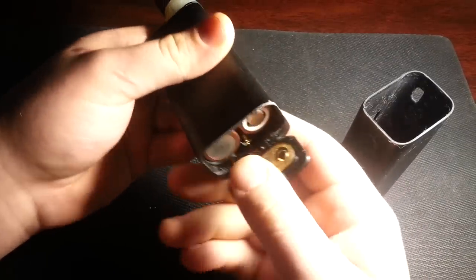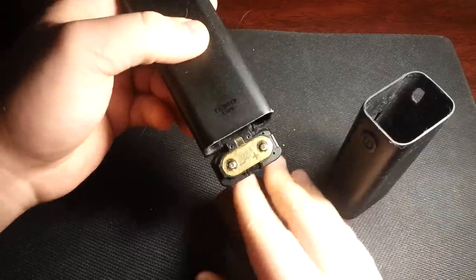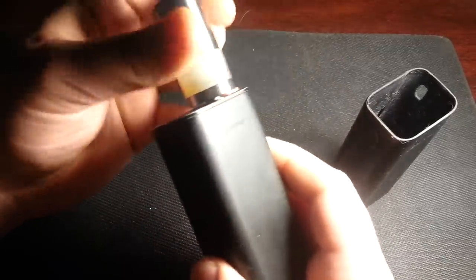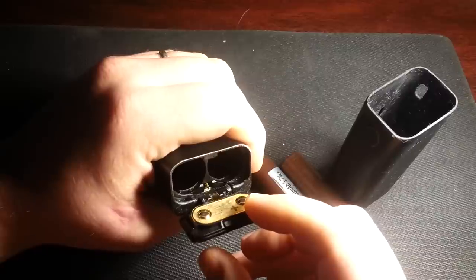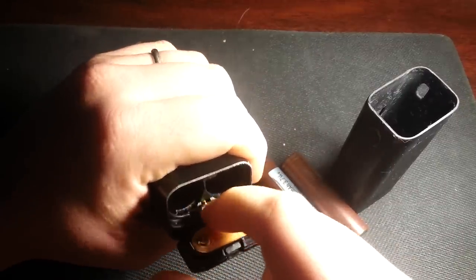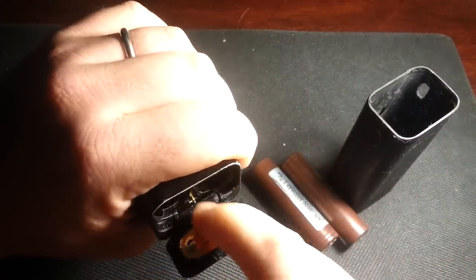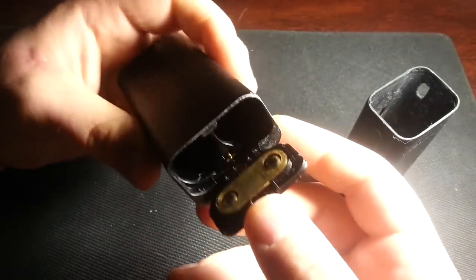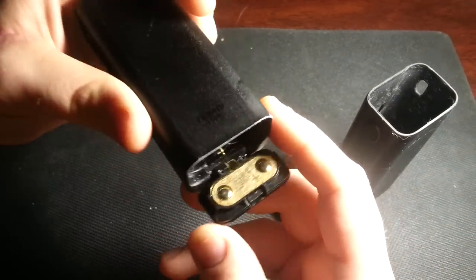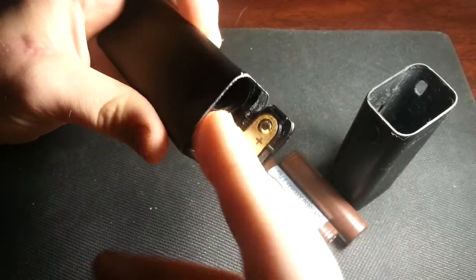What I did — it's been a while since I did it, that's why it's not working — was I took my batteries out, took the atomizer off, so I have nothing but the box, and I took a heat gun and blew inside where the pin is. That's where I found the problem occurred. As soon as I did that, I had no problems with my atomizer. I had the heat gun set to 180 Fahrenheit, with the highest blow setting, and just channeled it in there.